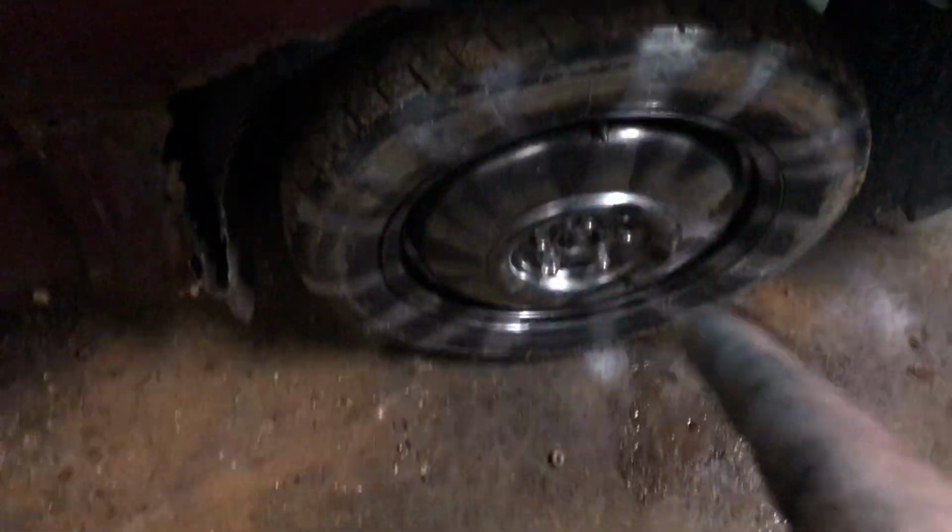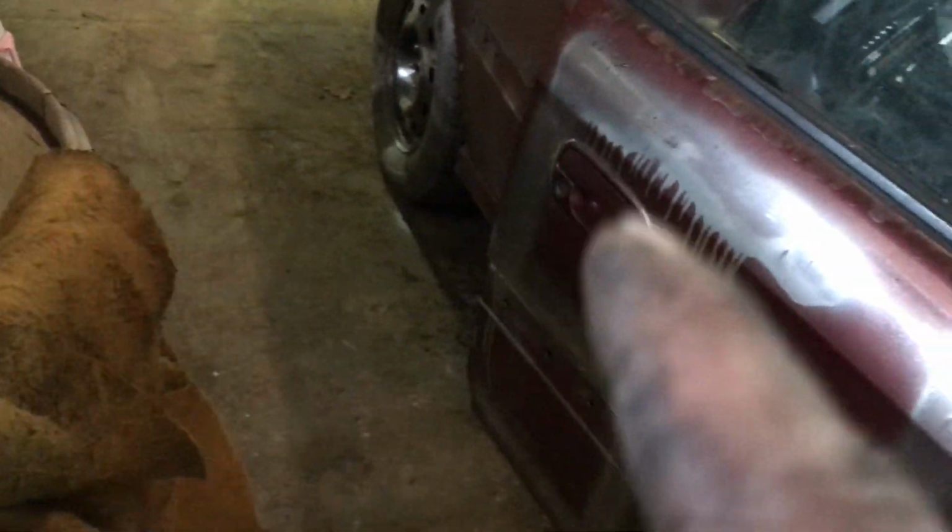And we had to get 2 new. I guess I didn't switch the wheels yet. We're going to put these on the back. The reason they're on the front now is because they wouldn't fit. I got 15-inch back there. They were supposed to go in front and they won't clear the calipers. So I had to go to work and we bought 16-inch steels.